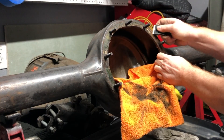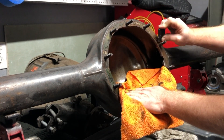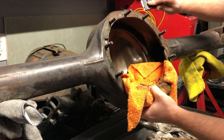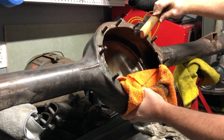One of the first things I did was go ahead and clean the housing around where the third member goes in, to scrape off all the old gasket and sealant and just make sure I had a nice surface for when I was putting up the third member for all the measurements.